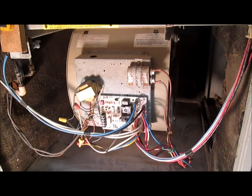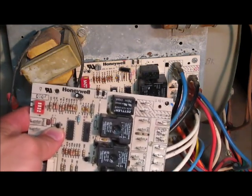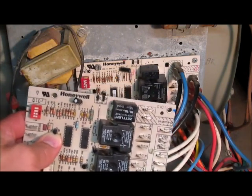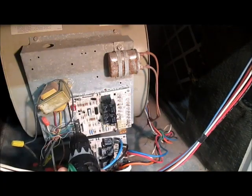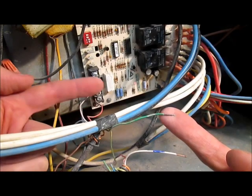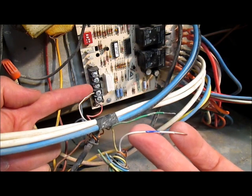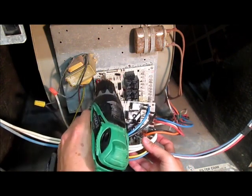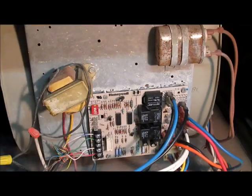Unfortunately, I also have a bad circuit board — you can tell if you listen. The solenoid that controls the blower motor is clicking erratically so I'm going to need to replace it. I found the part number to the board right here and ordered another one. Now with the power off, I'm simply going to move all the wires over from that board to this board one at a time so I don't confuse any of them. All my wires that went under the screw-down lugs here were pretty corroded, so I cut off about an inch or so and stripped back the insulation so I could have a nice clean wire to put under the screws. With all the wires switched over, I'll simply unscrew the old board and screw in the new one. And that sounds much better. Thank you for watching and good luck fixing your gas furnace.